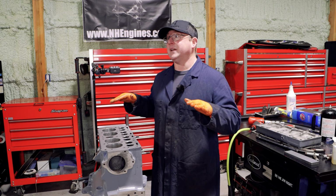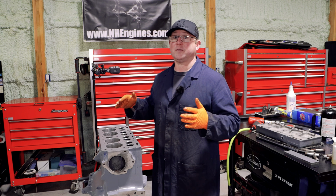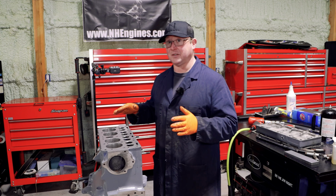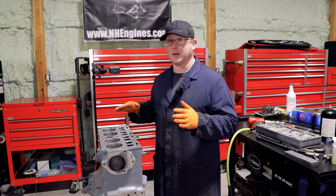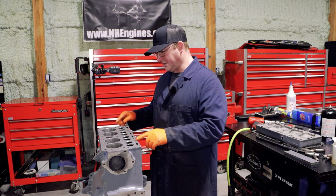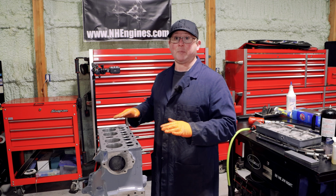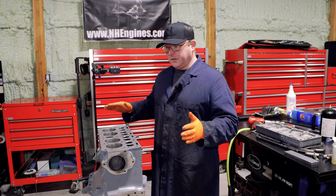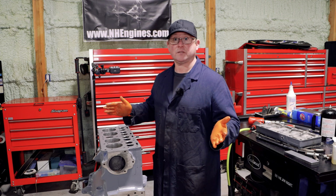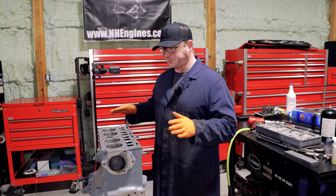And I'm sure my fellow machine shop owners won't thank me for saying that, but it's a reality. You know, stoning is not the bad thing that a lot of younger engineers and machinists make it out to be. It's a legit technique that was used for a very, very long time, and you can get some spectacularly accurate results with it. I think that this block can be saved that way, and I'm going to continue with it until I've got it happy. And if for any reason it doesn't come good, I can still deck it. Nothing's lost. You're taking off such a small amount of material, there's no real loss there.